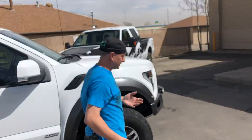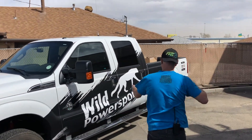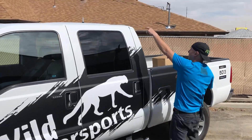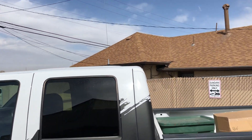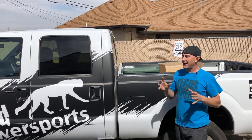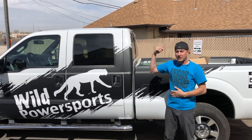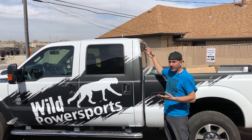This is a ground plane antenna, just like on the Can-Am Maverick we showed you. This is one of our chase trucks, and up there is a ground plane antenna. It's mounted with 18 inches around it and it's got great reflectivity for the signal. And I'll tell you right now, this radio works better than any of the ones in any of our vehicles — just because it's the correct antenna on the correct vehicle.